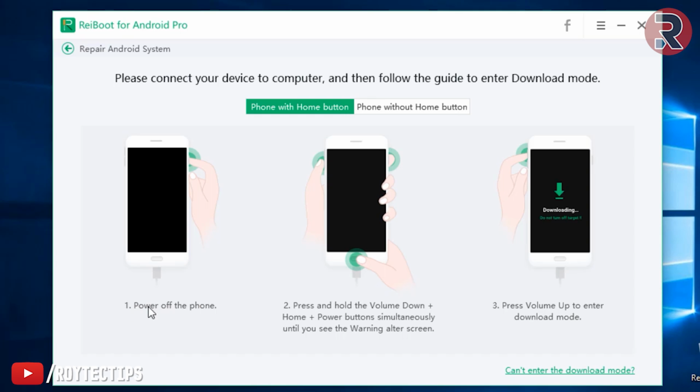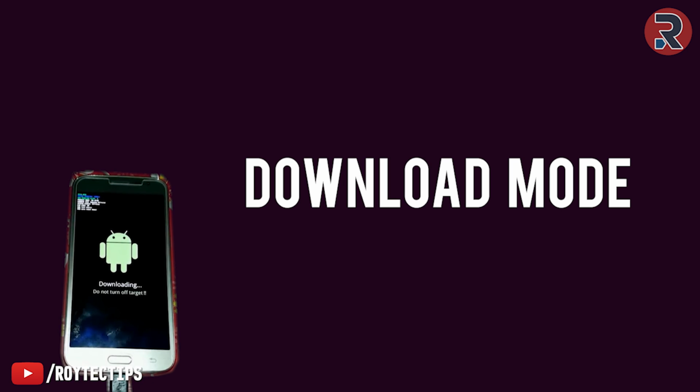Now you need to power off the phone. Press and hold the volume down plus home and power button simultaneously until you see the warning alert screen. Then press the volume up button and enter into download mode. And as you see guys, the phone already entered into download mode and it will download the firmware from the PC via USB cable into the phone and flash the phone.